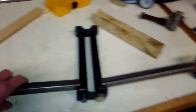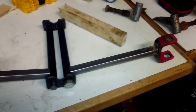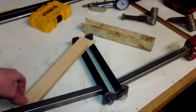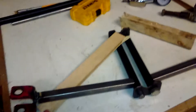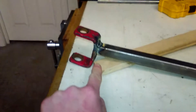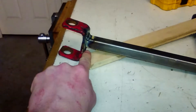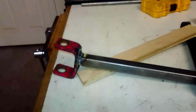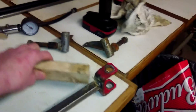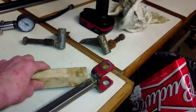I'm going to run it towards the front of the quad, and then there's going to be a piece that goes up to match this angle here and then welds to the bottom here. It'll be stronger that way rather than just coming straight to this piece.